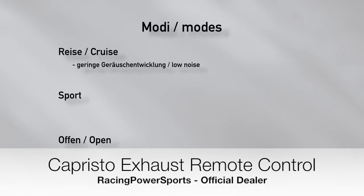In Cruise mode, a low noise development has priority. In general, a higher back pressure threshold is set so that the valves can stay closed at a moderate driving style. In case a temporary higher power is demanded, the valves have to open in order to protect the engine. Thus, the highest possible back pressure is limited to 200 millibar. The default value is 150 millibar.